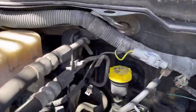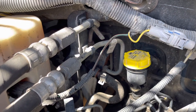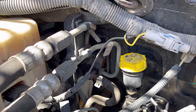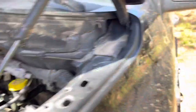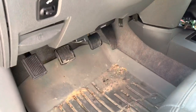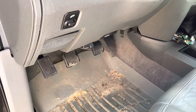Our reservoir is here. Step one: take your cap off, look in there, and see if there's brake fluid in there. If it's dry, that's your problem. Mine is probably getting low or dry over time. Simply fill it up with brake fluid, then come inside the truck and start pumping your clutch pedal. If you've lost your pedal altogether, I'd do 20 to 40 pumps and see if your pedal comes back. If it does, that may be all you need.